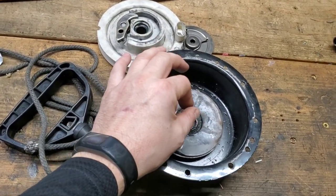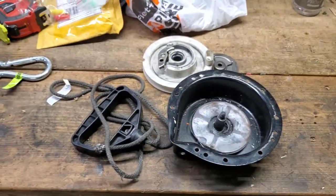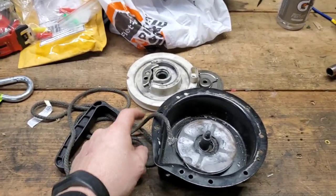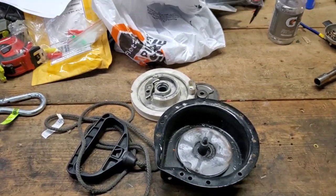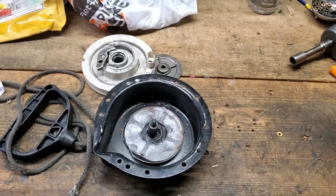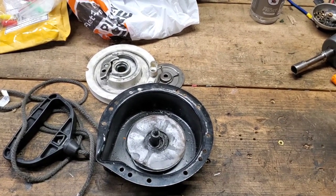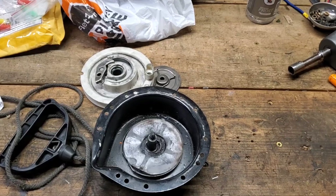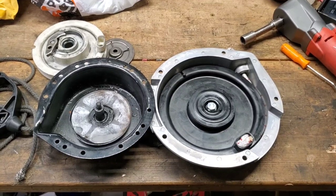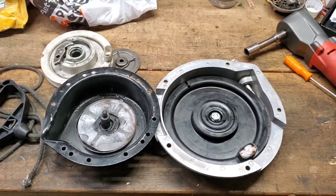Here's one I've used in the past — that inside gets wallowed out and it's no good. The one that's in there right now started doing the same thing, but I actually snapped a pull cord on a really cold morning last weekend. So there's a fix for that. Around 2006, Arctic Cat started making different sleds with bigger, heavier-duty recoils. You can adapt the old Arctic Cat to the new style recoil, which is bigger in diameter so it doesn't pull so hard on the cord and pulls the motor over easier. I'm going to show you how to make an adapter for that.